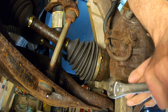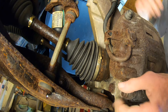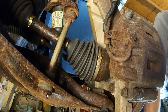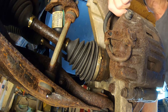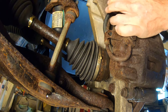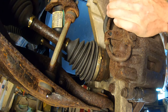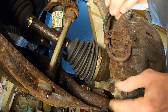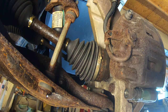We're going to reach down and loosen the bottom caliper bolt before we take them out completely, either one of them. In the case of this Explorer, once they were initially air broke free, they turned out just with your fingers. I'm actually multitasking here — turning the top and the bottom one out. They are a fine thread bolt; you seem to turn and turn until they ever do come out of their spot. They're turning out now, nice and easy from this point forward.